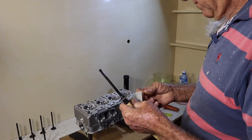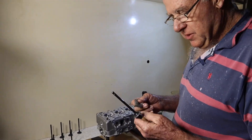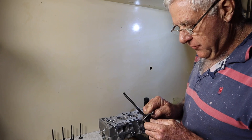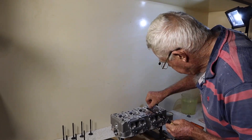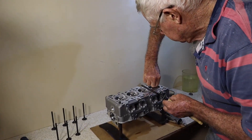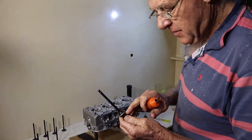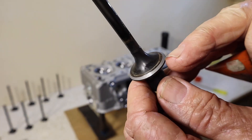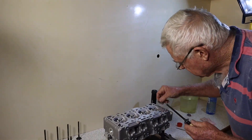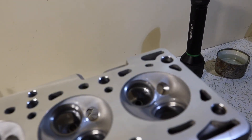I have small pieces of rag here and you just wet them in a bit of water, because it's water-based paste. If you wipe them off dry, they look clean but they won't be clean. If you wipe them off wet, everything turns out a lot cleaner. Use each piece of rag just once. They look like they're going to turn out really good — have a look to see there's no pit marks or tracks right through. And looking at the seat itself, you can see it's the same colour all the way around — it's touching all the way around.